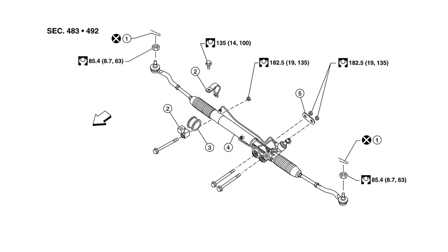Here's a look at the steering rack and all the connections. You'll see the three bolts here that hold the rack to the frame and the brackets there. The connections, and we have a look here at the inner and outer tie rods. That's really mainly it - it's really those three bolts and those outer tie rod ends that hold it all in place, and then you have a high pressure and low pressure connection at the rack there.